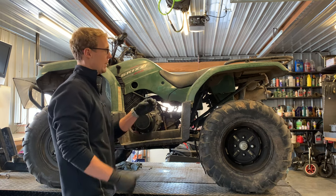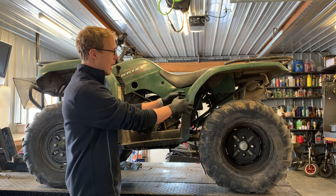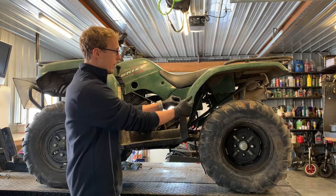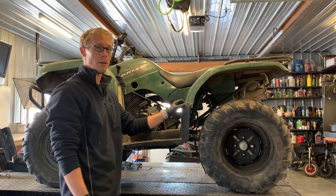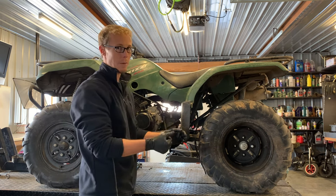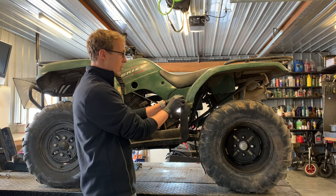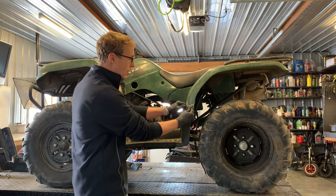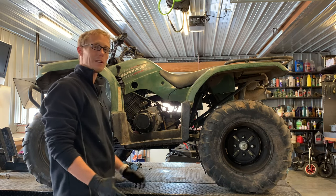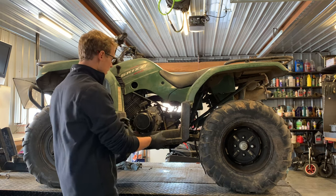You don't want to typically heat those up. I've seen some guys get an angle grinder out and try grinding the head off. The problem with doing that is you actually heat this plastic up — it'll feel like you're coming off really well, but you're ripping that all the way through your footwell, and worse off, you're going to pull that right through your fender. Try not to use an angle grinder unless that's a last case scenario. If you have to, you can heat that bolt up a little bit, pull it straight through, and then get a slightly bigger washer to put over top.